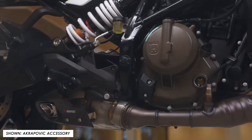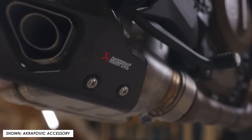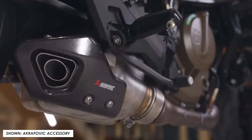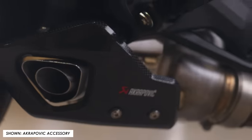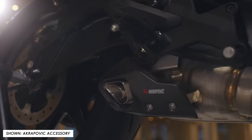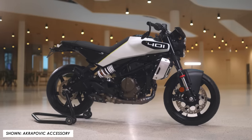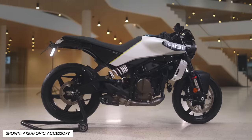Also, the curve in the swing arm allows a bit more space under the bike for the exhaust system, and that's also been redesigned for emissions reasons. And look, with modern day bikes being so restricted by those laws, the catalyzers can be quite weighty. So mounting them low can help to keep the center of gravity low on the bike, and that should have a positive effect on the way the bike handles.